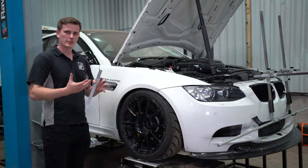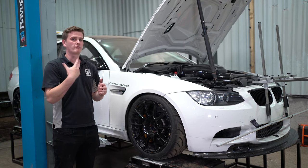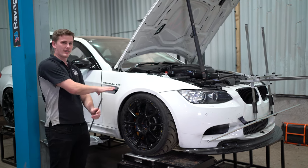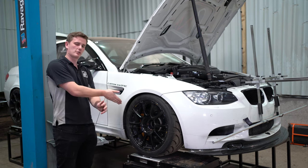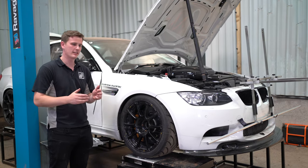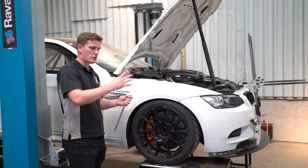Toe settings depend on the chassis, platform — front wheel drive, rear wheel drive, four wheel drive — and also the use of the car. For a road car you'll tend to toe in on front and rear axles to keep the car stable in all weathers and terrains, taking safety factors into account. If the car is aimed at track use, you can introduce some toe out — toe out on the front axle makes the car more pointy, helps with turning, and reduces understeer. Being rear wheel drive, we'll keep the rear axle toed in for traction and stability at speed. You can have a mixture of toe in and toe out front-to-rear depending on use.